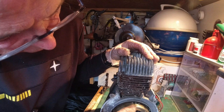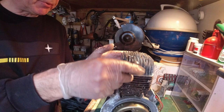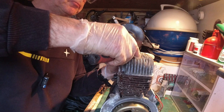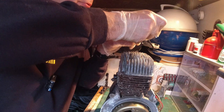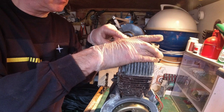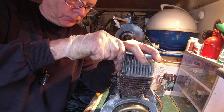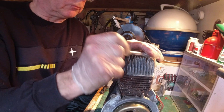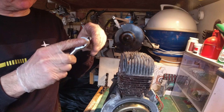I'm not too sure what to do about that. This is obviously the timing marks here as well, so I need to look into that before we start mucking around with it. Let's get this head off - hopefully just needs to be cleaned - and just check the state of the piston. I'll do this in a cross-hatched way. That's all four bolts out, so I believe this just needs a little tap.